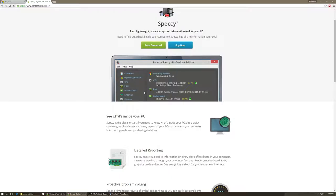If your computer is not working and you can't boot into it, then my suggestion would be to download 64-bit and try with that. When you try and install it, if it's not compatible, it'll say so, and then you can retry with 32-bit. But I'd rather you try with 64-bit first, because I don't want you to put 32-bit on your machine since that will run no matter what. And if you have a 64-bit processor, you're really going to reap the benefits of having that 64-bit OS. So do the 64-bit one if you don't know.